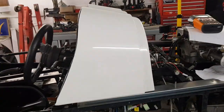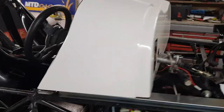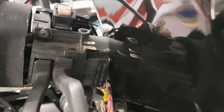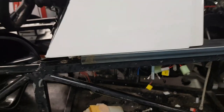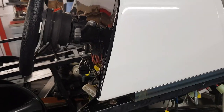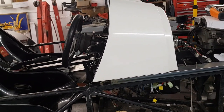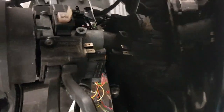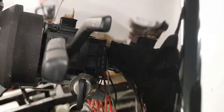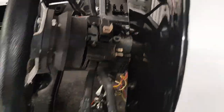Something that did just pop back into my head - when I was fitting the steering column and tried the scuttle on, I did remember there was hardly any room between the switches and the scuttle where the plugs go. The plug is right up against the scuttle on this side and it does still need to go back slightly to where it needs to be. The other side's got a little bit more clearance. I think what I might do is just space the column back slightly just enough for that to clear, and then we can decide whether I need to take a little notch out the bottom of the scuttle just for the plug. So I'll wire it all up for now.